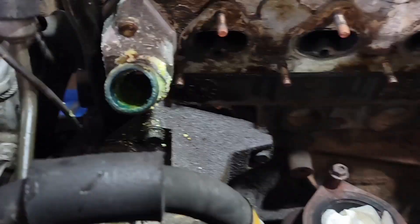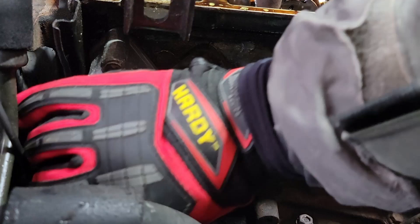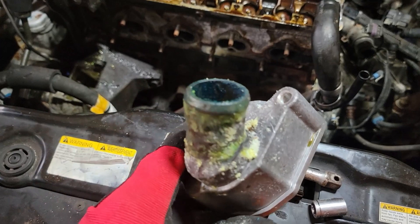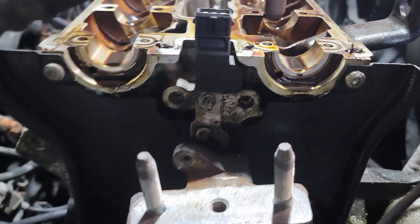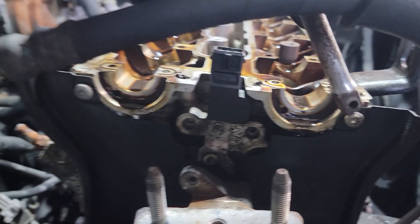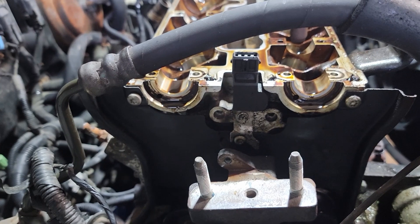Now it's time to see just how corrosive the wrong coolant can be on your engine. We are moving on to the thermostat housing, which only has two E10 E-Torx bolts — comes off real easy. When manufacturers say to use a certain type of coolant, don't say nah and use the cheap stuff. Always do a quick check around the head while you're at it, because there are four things we got to remove on the end of the head. We need to take off the cam sensor, and right underneath that there's a T30 Torx here and a T30 Torx on the corner. All of these are holding the inside of the timing cover — which is steel — to the side of the head, so you definitely got to get this done.